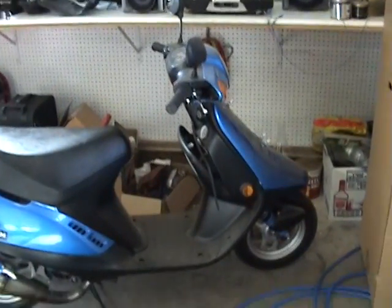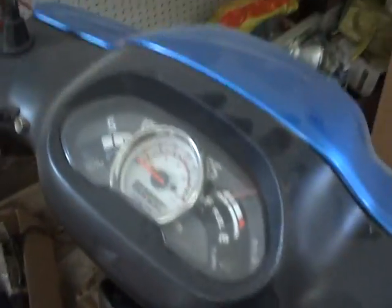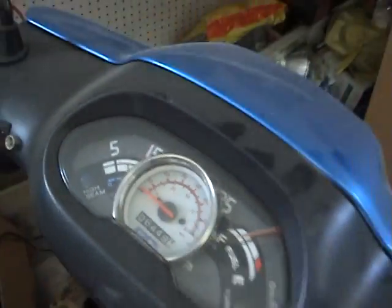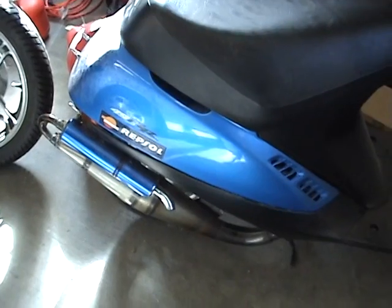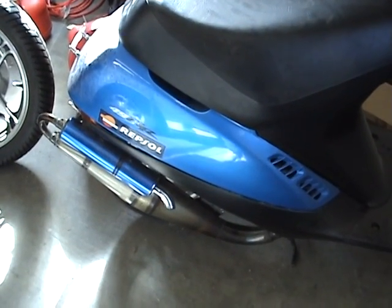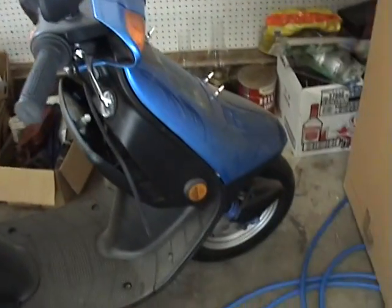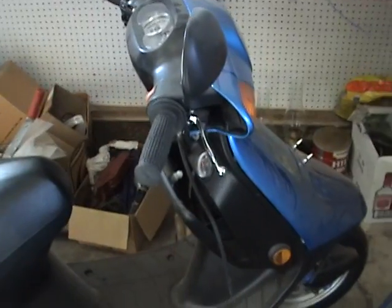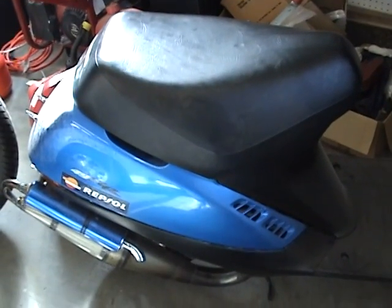I can say this in English because I don't know the metric system that well. I do have that though. Anyway, if you want the Dio to go faster, you'll have to change the rear gears. In order to change the rear gears, which I will show you, remember there's a trade-off. If you want a higher top speed, you're going to lose low speed. If you want a higher mid-range speed, you're going to lose something off the top or the bottom.